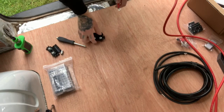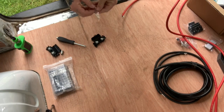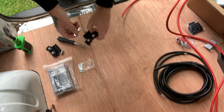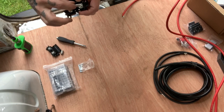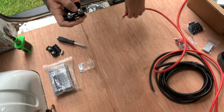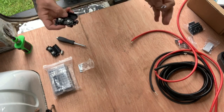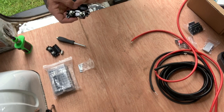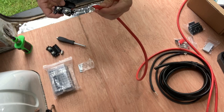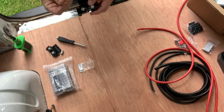The way we put the fuse carriers together — it's quite a simple concept, they're ready-made which is good. The fuse slots underneath those nuts and bolts underneath there, same for the other side, then the cover clips over the top. I would suggest not putting the fuses in until all the cable is in and routed to each battery, then put them in. If you've got the fuse in and you're threading cable through the van and you hit any metalwork, it's going to spark — and that's not good. So leave the fuses till last until everything is fully installed.